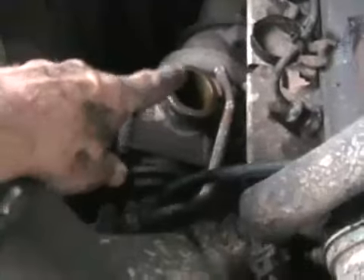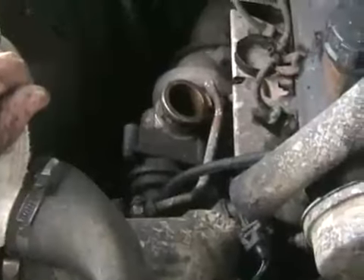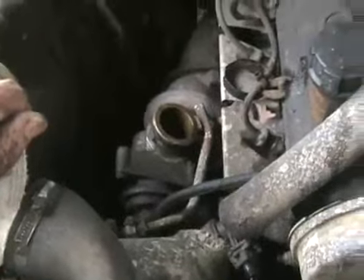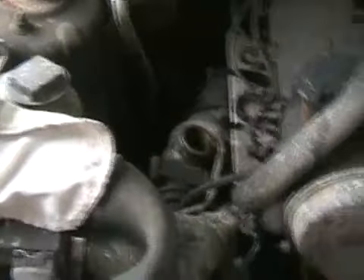I've already opened up the turbo and stuck my finger in there and spun the wheel. It's spinning good, because when you blow a hose on a turbo engine, there's no coolant to cool your turbo and you can seize your turbo up. This was a unique rad hose — it has this little T on it, and that feeds the turbo with coolant to keep it cool.